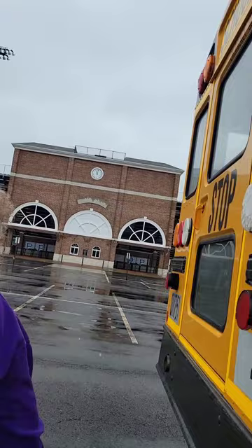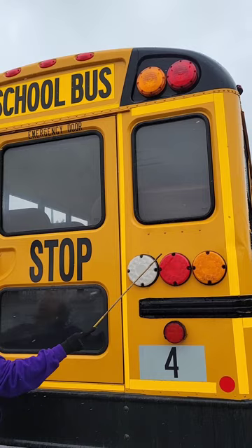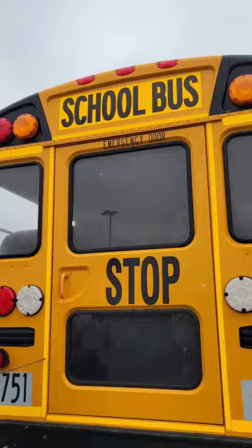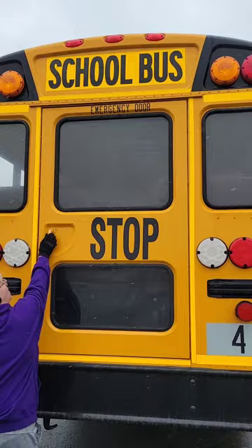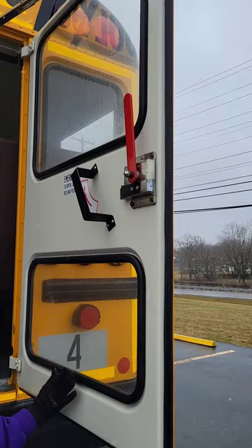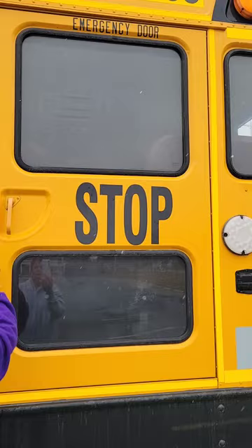Back here I work top down: my three red clearance lights, my amber and two red student warning lights, my two amber turn signal four-ways, my four red daylight brake lights, and my two clear reverse lights — all secure to the bus, not broken or missing. Reflective tape is not ripped or torn, including my two red circle reflectors. Some buses will have plastic reflectors — you can include those with your lights. When I lift the door handle, lights and buzzer come on inside. Hinges and bar are not bent or twisted. Door opens easily and locks in place — no trip hazards. The door and window seals show no signs of leaks, rips, or tears. When I close the handle, lights and buzzer go off. My windows are not broken or missing.